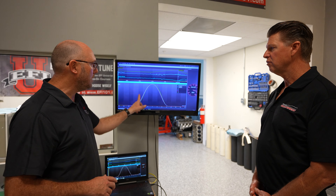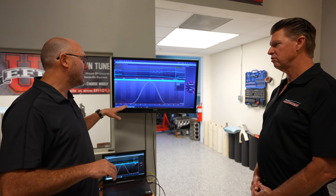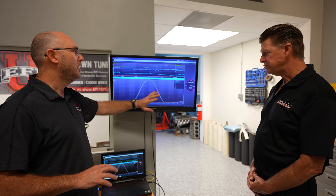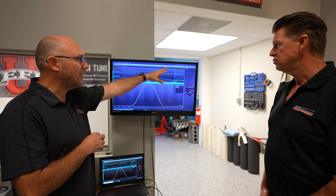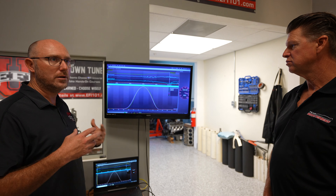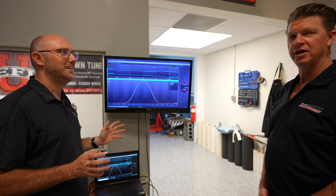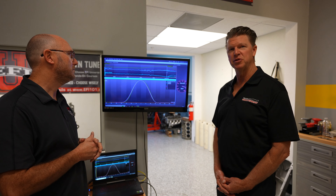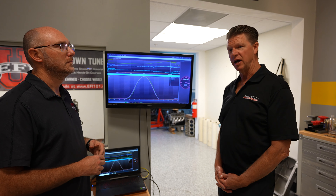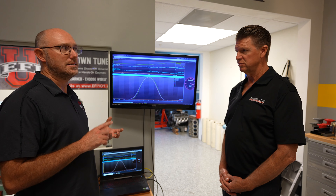We'll never get this line to be perfect because we're not going to have an infinitely stiff system. What we're trying to do is contain it enough so that the diving board doesn't pitch it way off into the graveyard. In my opinion, this is a system where at 8,500 RPM there is zero detectable valve bounce. We're not crashing it up here. If we were in desperate measures, we could go race that right now. But it's going to get so much better by the time we're done. What he's talking about with the tools is some of the stuff that will be changed here is our stiffness — how we're holding all this hardware under the head. The pushrods are going to play into this thing.